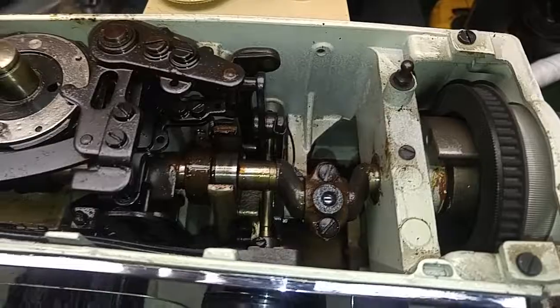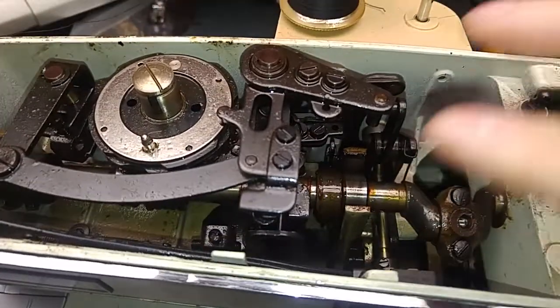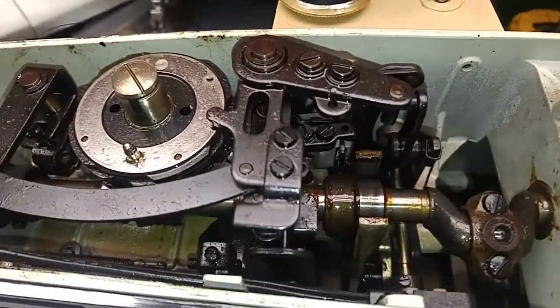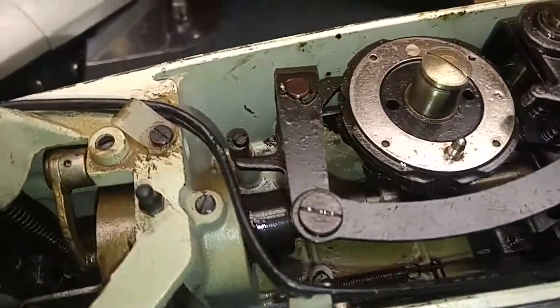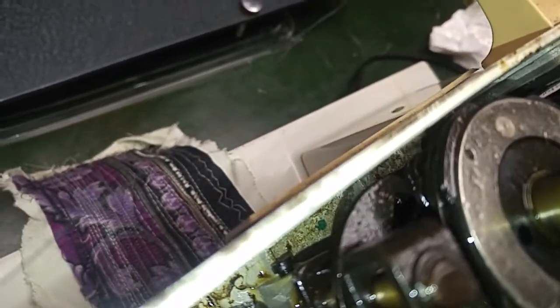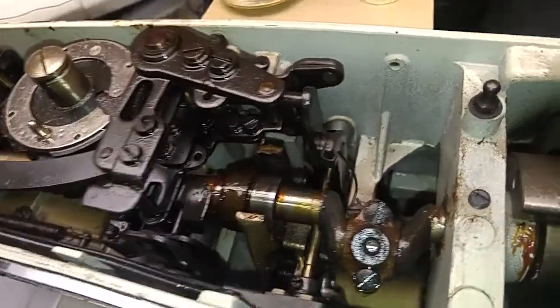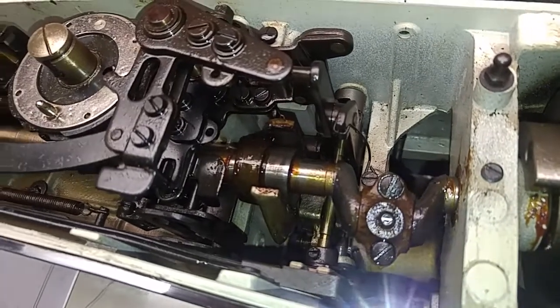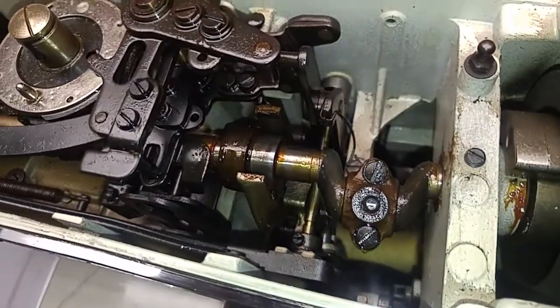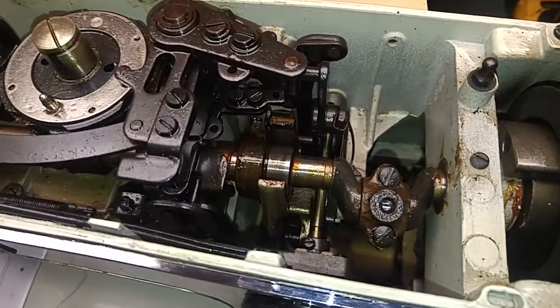There's a gearbox on the underside. You can see that black area back there. Super Lube with PTFE — I hear that's what many use — and tri-flow as an oil. Personally, I don't like fluorinated stuff if I can help it. It's bad enough that I use the corticosteroids, the Flonase and whatnot because of my allergies. That's my choice putting it in my body, but I don't know if I want fluorinated compounds everywhere else. So I'll try to use silicone or just natural refined mineral oil.